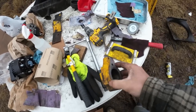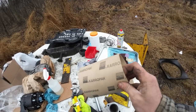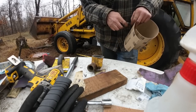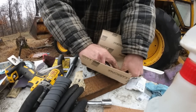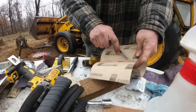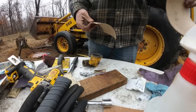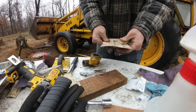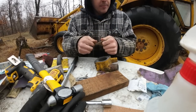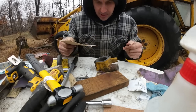We're going to make a new gasket for this thermostat housing. This gasket material just comes in rolls — they do make different kinds for different fluids, so if you take this on, make sure you get what you need. This one is good for coolant, which is what we need. I just like to start by cutting a piece that's somewhat close to the size I need. If you know you're going to be making this the next day, roll it out and smash it between two boards so it's flat.